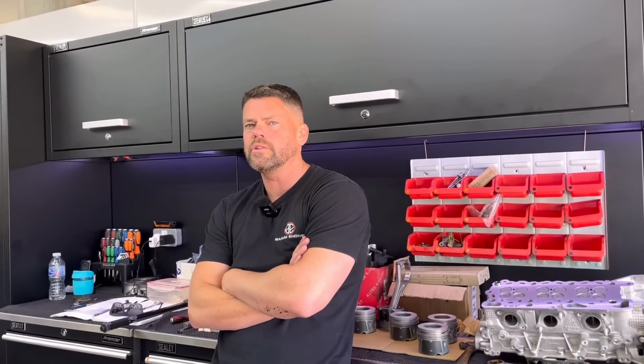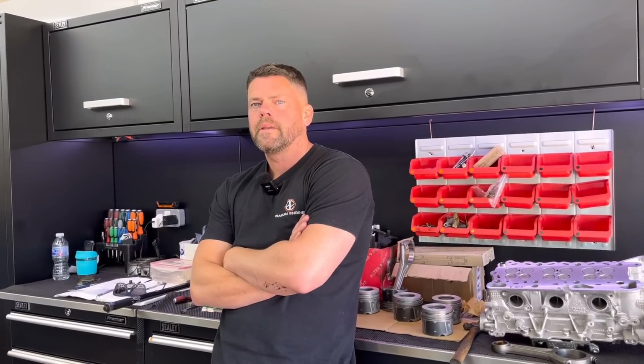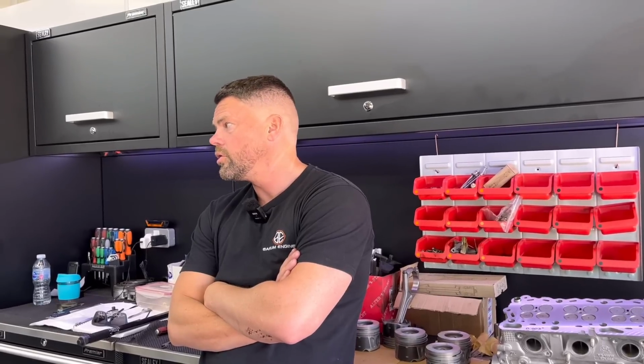Got an engine issue. Apparently, it's a known thing, even by Jaguar, that it's a DPF issue that's caused this. So it sort of gets blocked or something. Blocked up, fuel's wrong, maybe? I don't know. Yeah, I think so. And then, I don't know whether it sort of dilutes the oil. Probably. Washes the oil out and bloody does the crank. Most likely. Loads of white smoke, apparently, he said, which means it could be a piston or a liner issue. Or an injector, potentially.